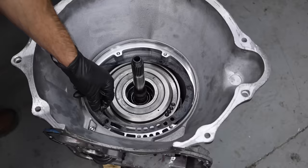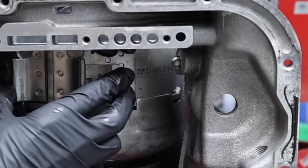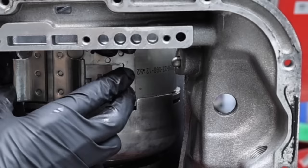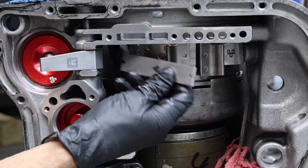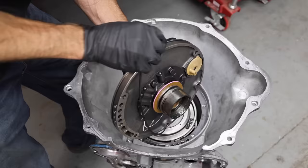Let's pull the pump and install the outer O-ring seal. Let's remove the pump gasket so we can install the second gear band — there's pretty much just one location that works for installing the band. I'll place a rag in the bottom right corner of the transmission to prevent an object from falling into the overdrive assembly. On the upper right side of the case, I'll attach the new billet anchor to the transmission band. The new billet strut slides into position around the tang on the band. Everything is in place, so I'll tighten the band adjuster a couple of turns so nothing falls off.